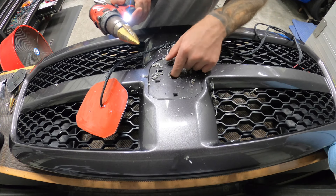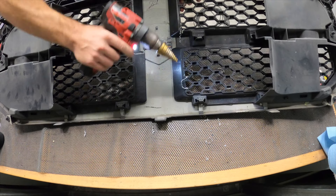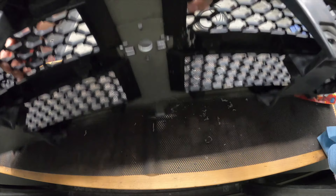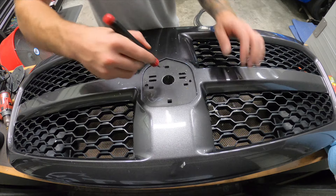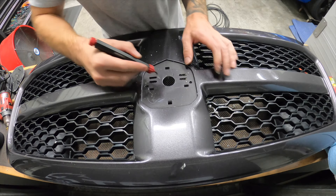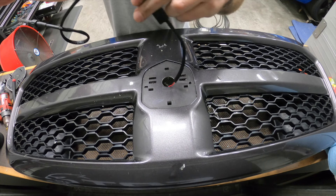I'm going to go to the other side, flip it over, and get that nice clean cut on the other side. We've got a nice clean hole. If you want, you can use a deburring tool — I'm going to do that here, run it around and make a couple passes to make this hole super official looking. There we go — a nice clean hole.